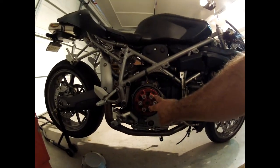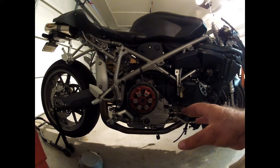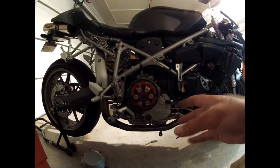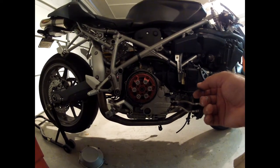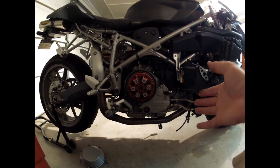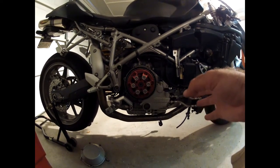There are principally two different ways that I know of doing it. The cheaper of the two ways would be to actually remove two opposing springs from the clutch basket. The problem with that is friction force is a product of normal force times the coefficient of friction. If you remove two of those springs, you basically reduce the amount of normal force and therefore the amount of friction force available for the transmission to transfer power. So you could end up having the clutch slip, which for me is not really a viable option. I like to do things the right way.